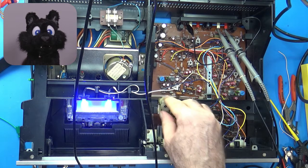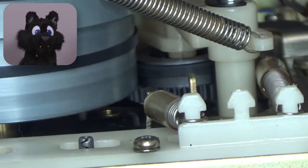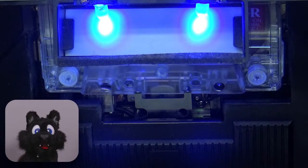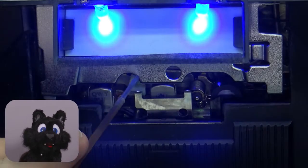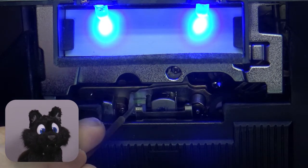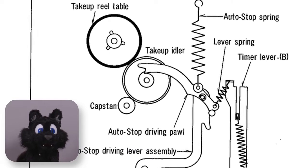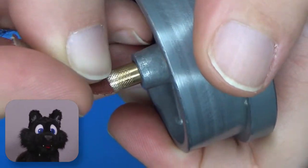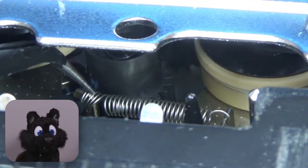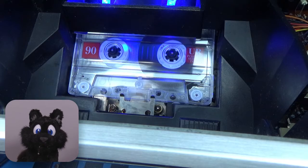The mechanical side had two issues. For one, the rewind would stall when the tape was almost rewound — the rubber wheel was slipping, so I had to treat that surface again. The other issue was the autostop. This deck only has autostop for play, and there were multiple things wrong. First, the detect lever spring was too tight — the tape wouldn't even activate the lever. Next, the stop action was too tight and the idler wheel just slipped. I tried several things: conditioning the rubber on the idler, roughening up the surface of the capstan where the idler pushes in, tightening the spring that brings the idler in, and then I even tweaked — that is, bent — the detection lever. Behold, autostop!